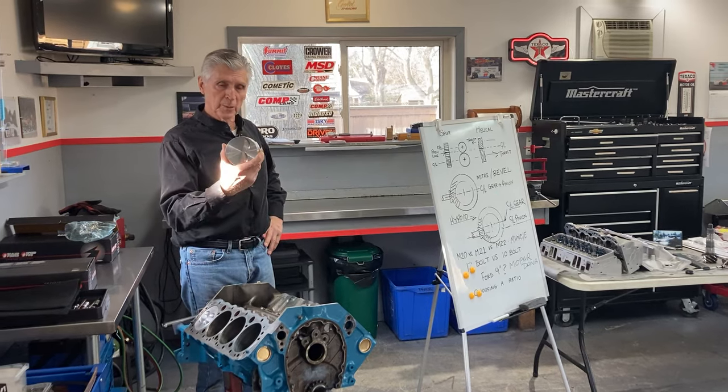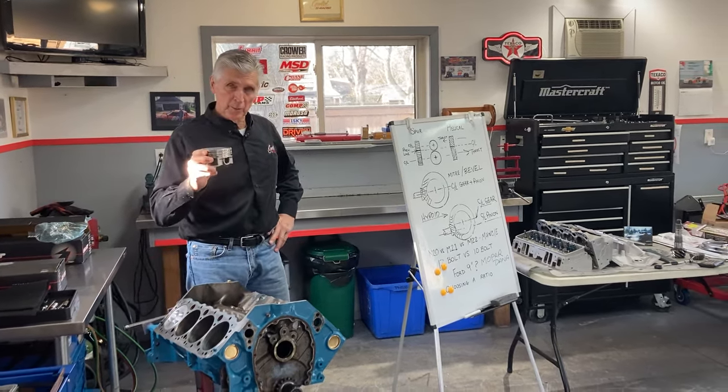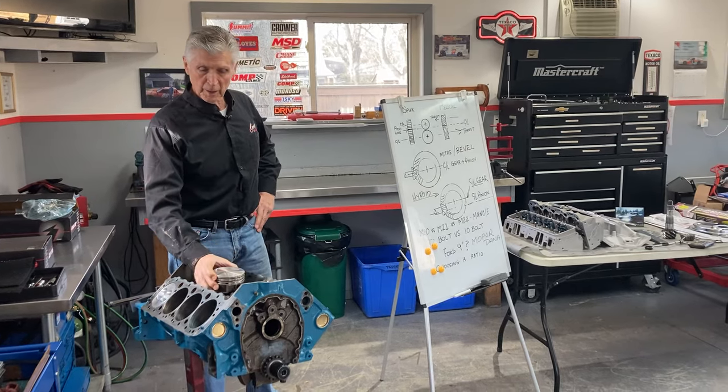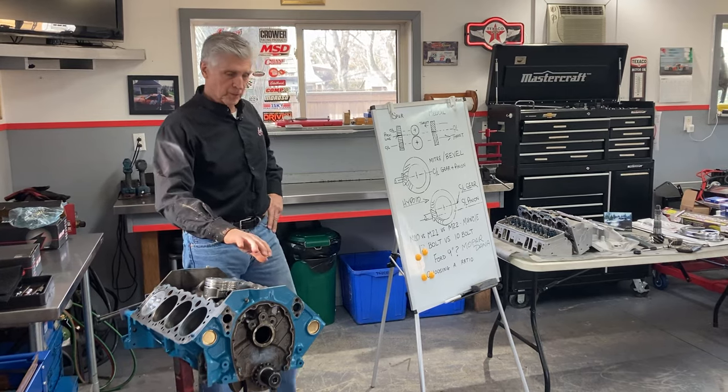I just got his pistons on a weekend. We did that because we wanted to improve our quench height. These pistons are two valve reliefs instead of four, and they're also going to increase our compression a little bit. That is a subject of future videos.